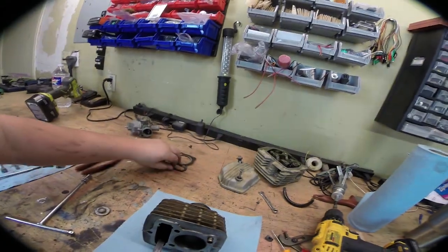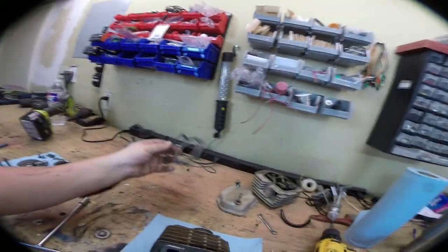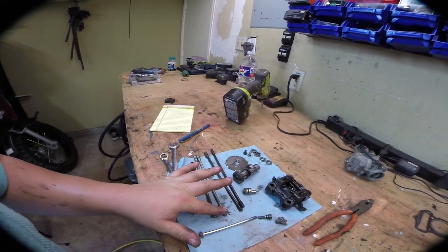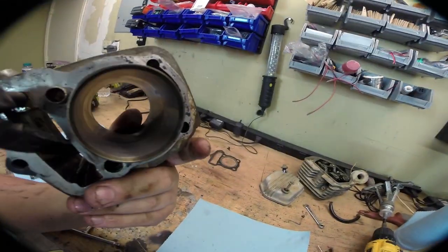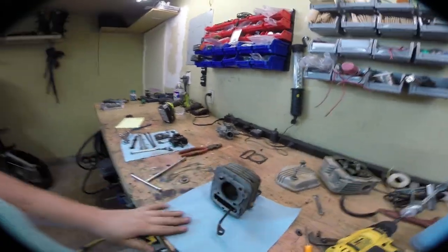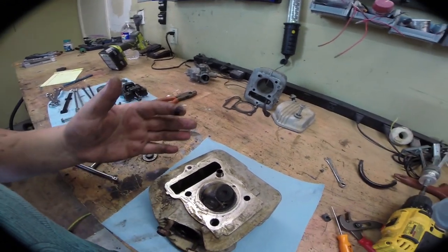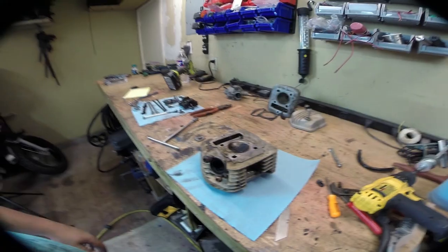If we come over here and take a look at the jug — these gaskets were in really bad shape. This one was obviously damaged before I even pulled it off. We may have gotten lucky and our compression leak was just gaskets and these stretch bolts. I don't know if they need to be replaced or not, but we might order new ones. I honed out the bore and it looks immaculate — there's just a few small striations, nothing too serious at all. So we can set all of this aside. Now the real question is this guy — this is our head. While it looks a little crusty, nothing here is telling me that I'm going to have a leak, so we're going to pull the head apart, clean the valves, and lap the valve seats. Put everything back together and hopefully it should be fine — we'll get some new gaskets, some new bolts, not a big deal.